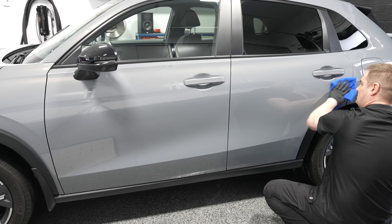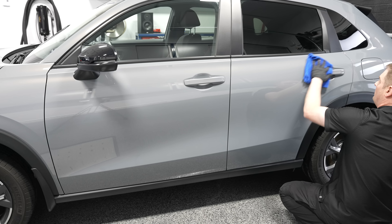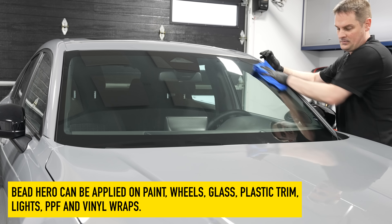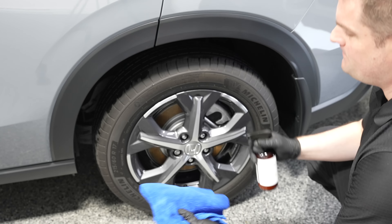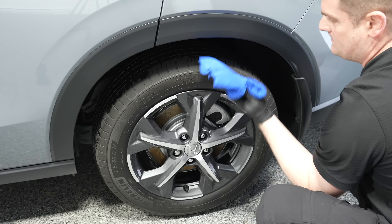For the first application as the base layer, apply on dry paint. In the future, know that you can use this on wet paint as a drying aid, but you'll diminish performance and durability a bit. For best performance and longest durability, apply on dry. We also applied the protection to the glass surfaces — the windshield and all glass around the vehicle. We applied it to the headlights and tail lights, because those tend to yellow and oxidize over time without extra UV protection. We also applied it to the plastic trim and wheels to make them easier to clean during maintenance washes. Let the paint cure — leave it untouched for at least two hours after application. No contact with water or rain. Ideally let it sit overnight, 24 hours of curing, for even better performance.